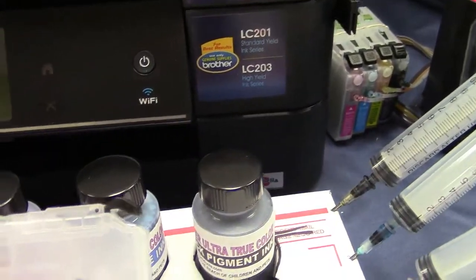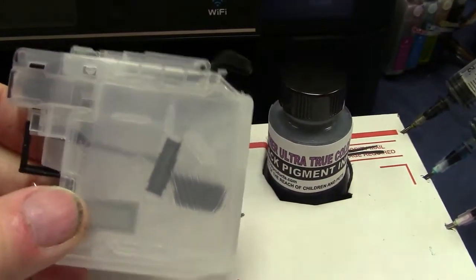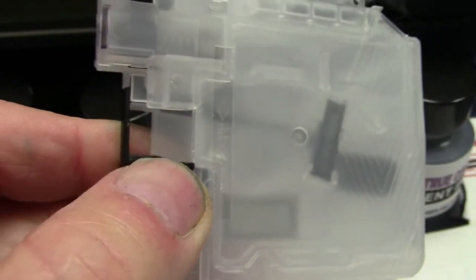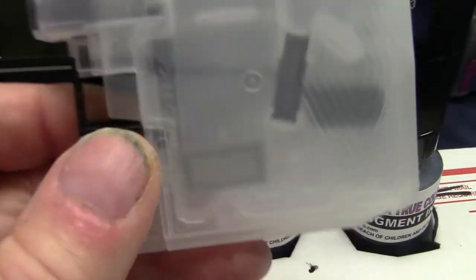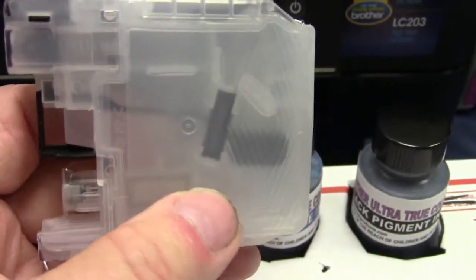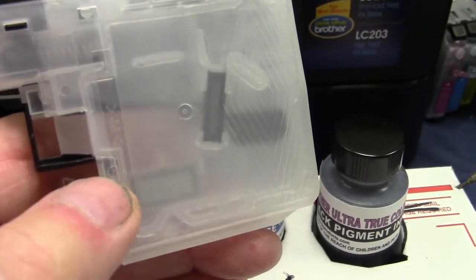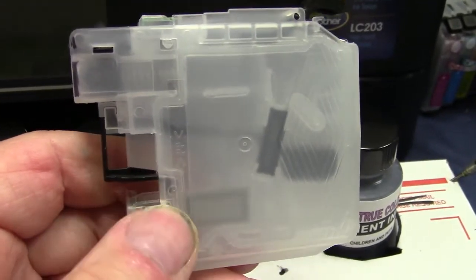Even though, the Brother cartridges, you can do it, we have a kit for it, you have to use a chip resetter, but with the newest COC Smart chips, doesn't require that. Now right in the center, right here, can you look right there? That is a little window, and the beam of light shines through that. When the little sensor in the cartridge itself, when you fill it up, it rises and it covers that. So does the ink. Well, as the cartridge gets lower, goes empty, then that gets exposed and the printer tells you the cartridge is empty.